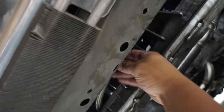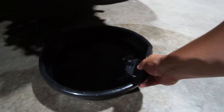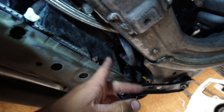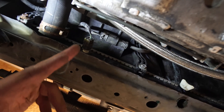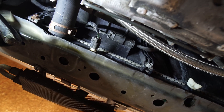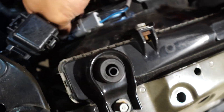We'll start with the white drain plug to get the coolant out. Next we'll work on getting these fans out. The only hardware we have from the bottom is this 10 millimeter right here and another one right here — you just loosen these and the fan slides into the bolt right there. Unplug the fans and then unplug the temp reader right here. We're going to have to re-drill into the new radiator. Loosen them, unplug this fan up top, then we got 10 mil, 10 mil, 10 mil, 10 mil.